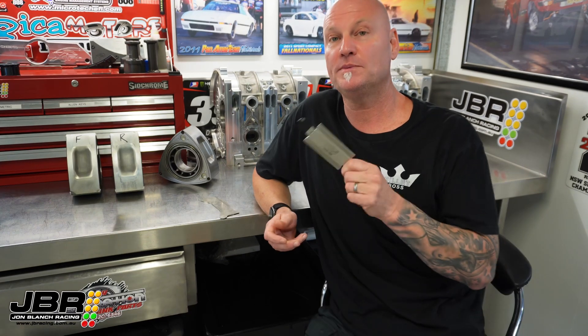The purpose of this tool is to get the slots or grooves for the apex seal in the rotor perfectly straight, perfectly true, and free from any damage or dings, so the apex seal can move freely up and down in the slot without any tight spots or binding in the groove. I know that sounds easy and simple, but it's not always that easy to achieve without one of these.